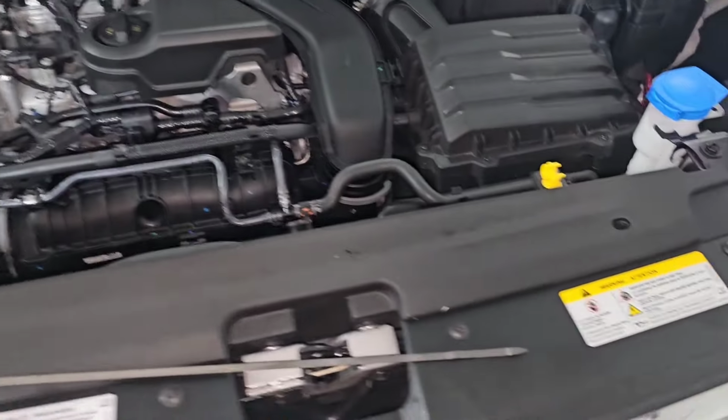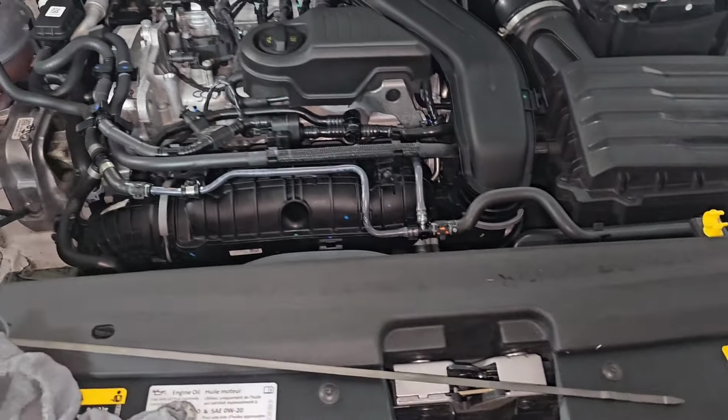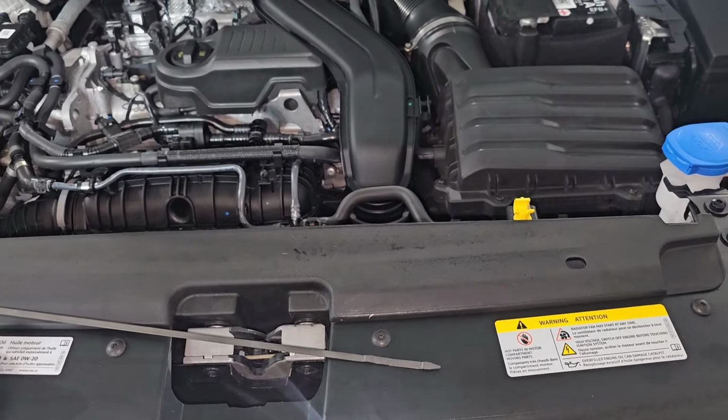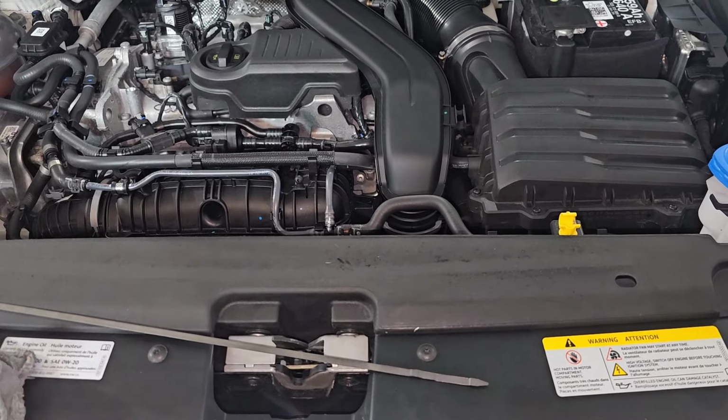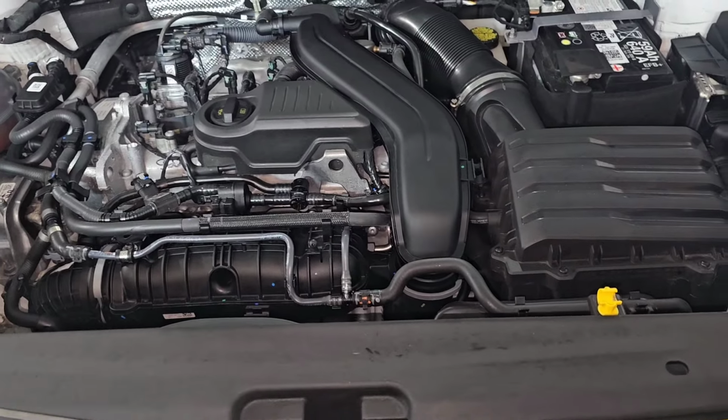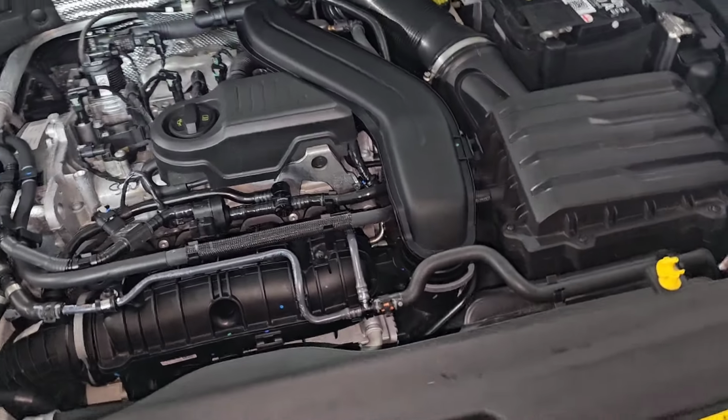Customer goes to service their oil, they're not going to know that. So these are some tricks and tips on the new Volkswagen Taoses. You have to be precise with the oil that you put in, or you will flag a message. So now I'm going to try to pull like 0.4, 0.3 quarts out and retest it again.